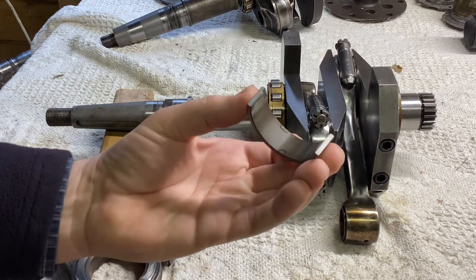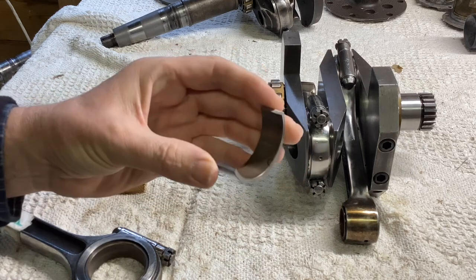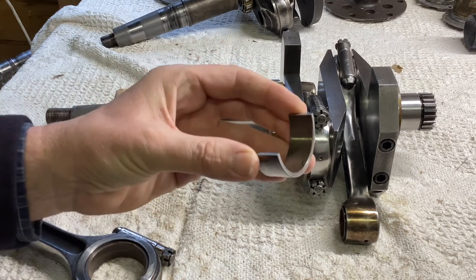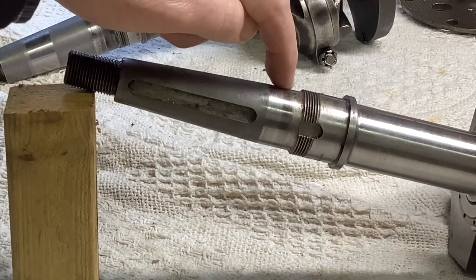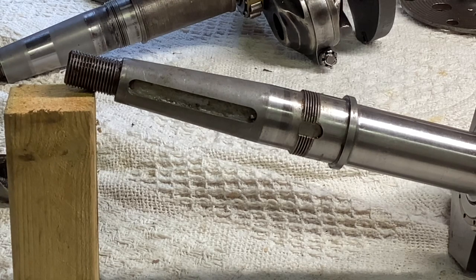The front of the crankshaft is an inch and a quarter in diameter. Very occasionally these crankshafts break — it is through ignorance and poor fitting rather than any particularly poor design, but I managed to do one several years ago. Note the back of the keyway here, because that's where the cracks emanate from. The Praga people obviously understood that because they made some changes on the Praga B engine to try and solve that problem.